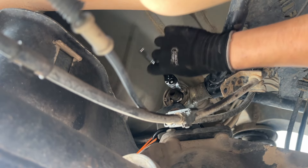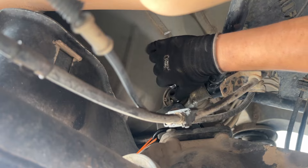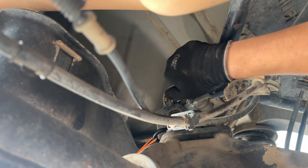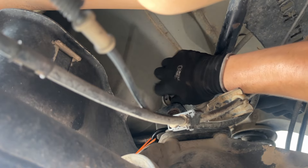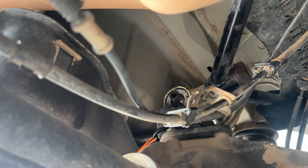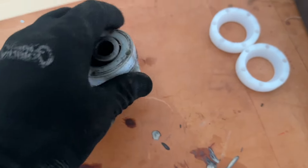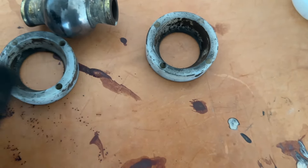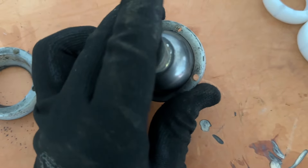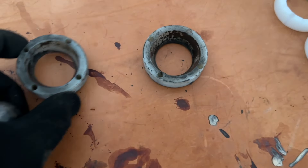I bought this A-arm used probably three or four years back. Honestly, I've never greased this joint — I know, bad on my part — and maybe that's why it probably wore out finally, but definitely grease your joints. So we got the last bolt out and that metal washer that holds the bushing in place is already wanting to come out. Now look at these — I just removed them and look how dry they are. There is literally no grease on this, so this is definitely my fault for lack of maintenance. Honestly though, these are not in bad shape. If you hold it to the ball they're pretty snug. I don't really see that much movement, so I don't think I needed to replace them — I probably just needed to grease and re-torque them.